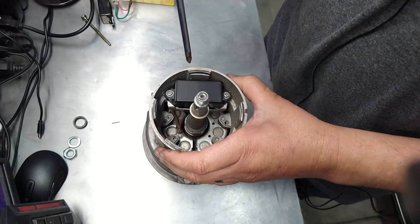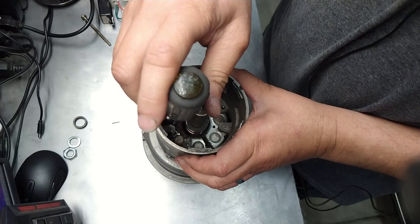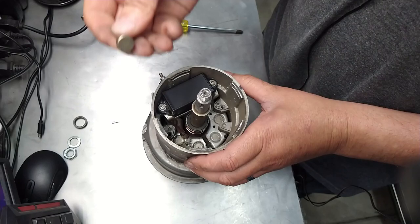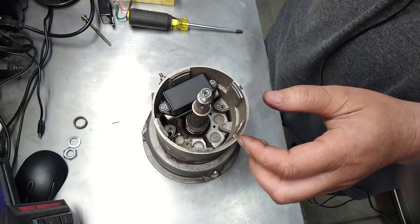Earlier in the video I said they have three. I didn't finish my sentence. Three anodes and three cathodes, okay? There's one, two, three back here, and one, two, three. When I say they're anodes or cathodes, I'm talking about the base. The base is the metal part. This is considered to be a base. In other words, they're basically the same thing, but they're reversed. So you've got to pay attention. You've got to buzz them out. You've got to know what you're doing if you go in there.